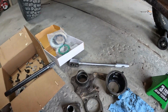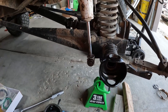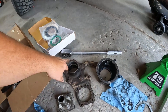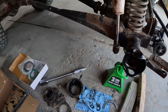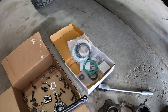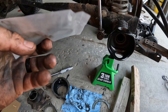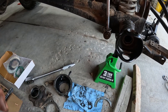We're all cleaned up and ready for reassembly. First we've got to put this axle seal in, then put our races in for the kingpin bearings, and then the races and bearings for the hub. The biggest thing on this axle seal — it's got a little groove and a spring. That's got to go in towards the differential so the flat part is towards the outer shaft.